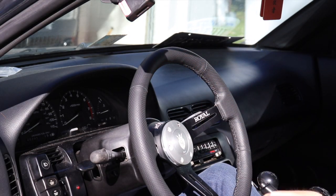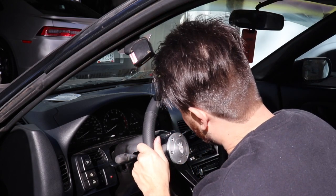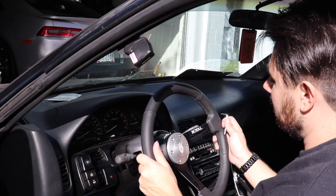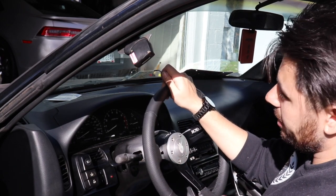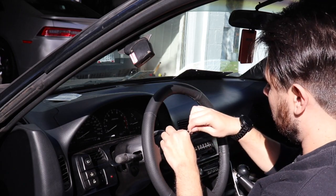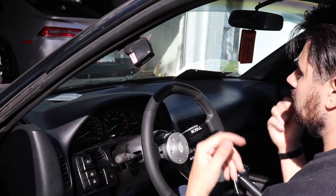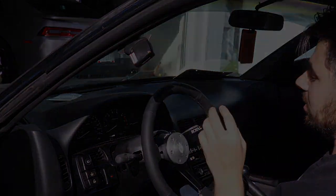Always shake the wheel when you're done — make sure everything's even. You don't want any play between the wheel and the hub. Shaking it loose like this shows we still have a long way to go before the horn and the wheel are secure. Once you have that play addressed and the wheel's on there, let me clean all this up and I'll show you guys how it looks in the car.